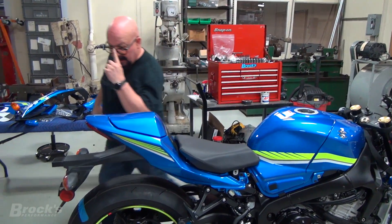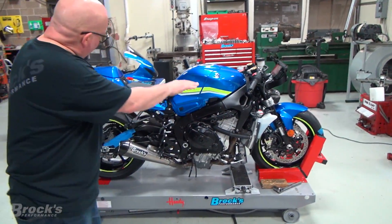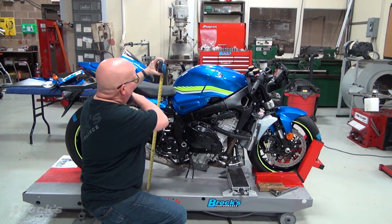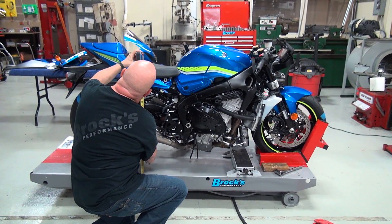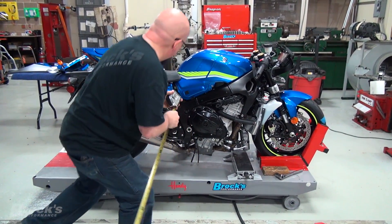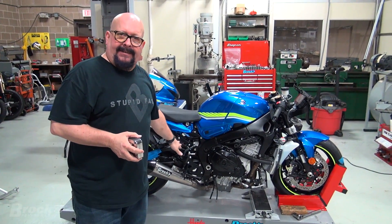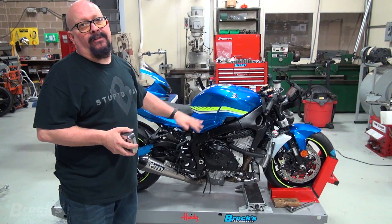Let's step back and see what we've got. You can see right now with the front end strapped - and we can strap it even more - this is very difficult to see with your eye. Let's assume the seat was flat. At the front we've got about 30 inches, at the rear about 30 and a half. So we have a slightly forward-pointing or downward-pointing trajectory to start with. What we're going to do is tighten up this link - this is a great place for us to begin.